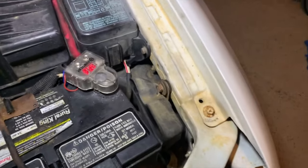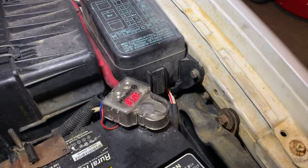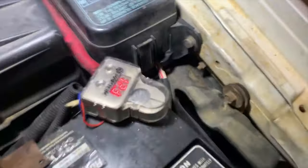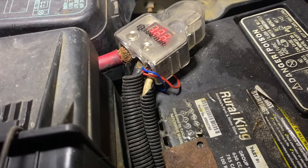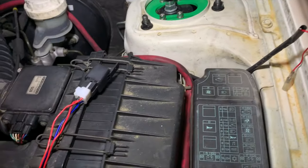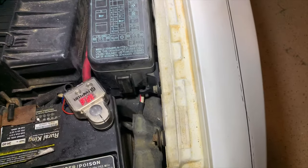I found a perfect place for the relay — we're going to put it right here. That's a 10 millimeter, we're going to take that off. On my battery terminal, which shows voltage — you can actually get this off of eBay, I think it's under $30 — we're going to add the power to this upper one. It's empty and not being used, so that would be perfect for power. Ground is body, so that'll be easy to find and install. And then this is where our wire ends up for the relay to turn it on and off, so that'll be an easy reach. Nothing needs to be extended — if anything, it may need to be shortened, which is a good problem to have.